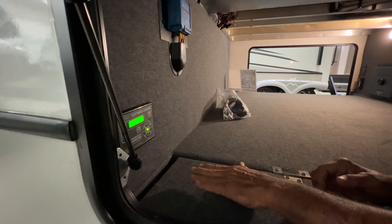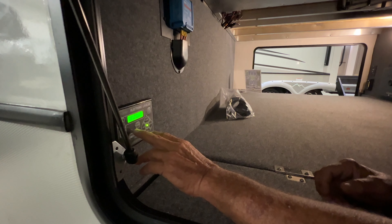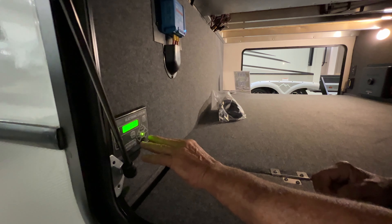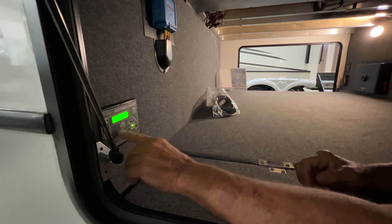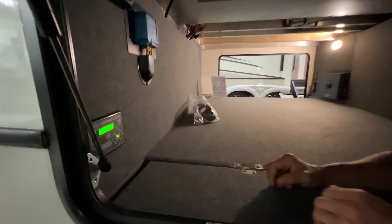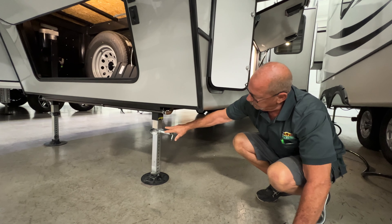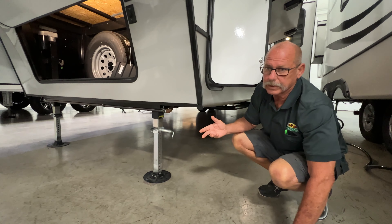In this position, all I've got to do is hit front and it's going to raise my camper up. Hit retract and hit front — it's going to lower your camper. As you scroll through, here's your scroll buttons. 'Drop front jacks — enter to begin.' If I hit enter, those front jacks are coming down. If your truck or something's underneath there, it's coming down on it, so make sure you're clear. Auto reconnect: if you're set up camping and ready to tear down, come in here to auto reconnect, hit enter — your rear jacks are all going to come up and your front jacks are going to set this exactly where you left it when you dropped it off. And here's your manual mode — if I hit enter I can control each individual jack however I want, just by hitting right rear, left rear, or whatever. I can manually level this completely by itself.